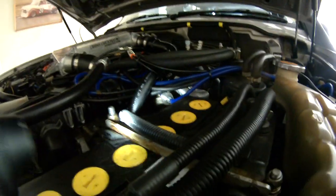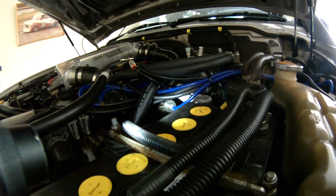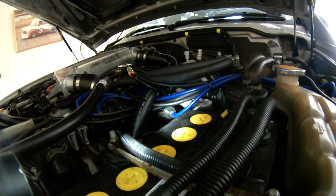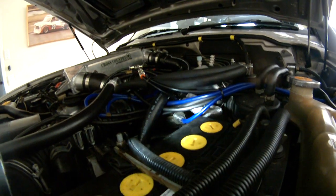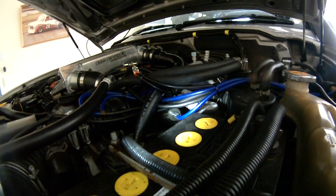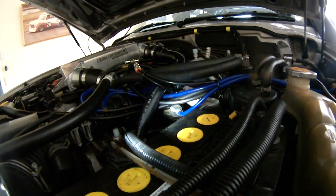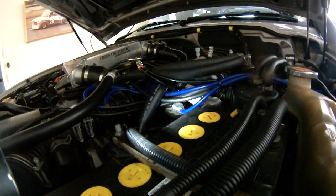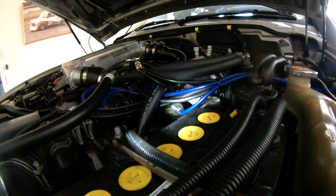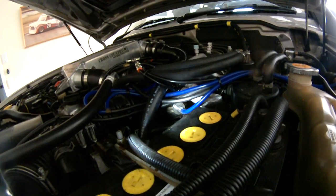The lower one runs across to the VNT, and just in front of it as it enters the VNT, I've got a lawnmower fuel filter. On the dyno I've had up to 8 horsepower variation due to bounce from the doors and the VNT diaphragm. Fitting this little surge tank in there took that problem right away.